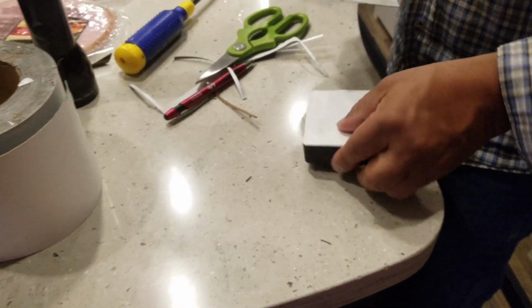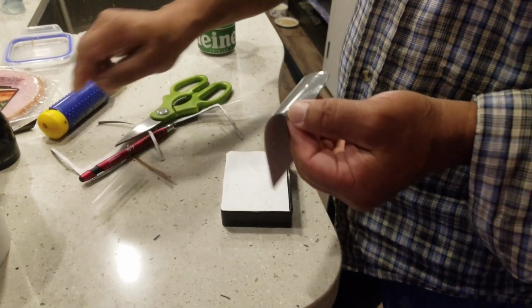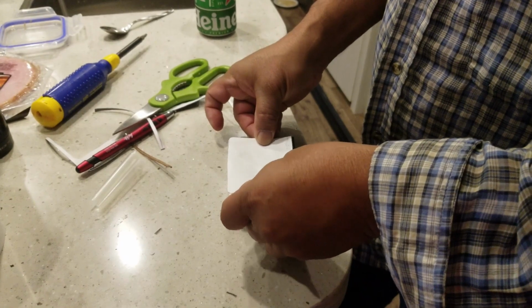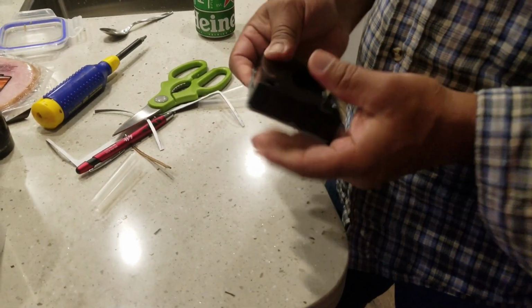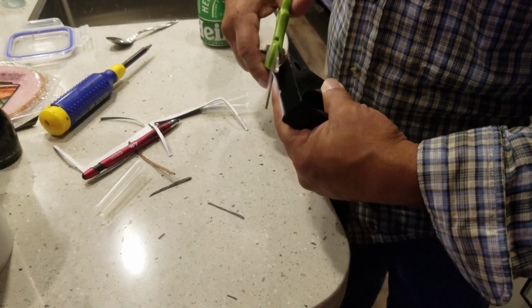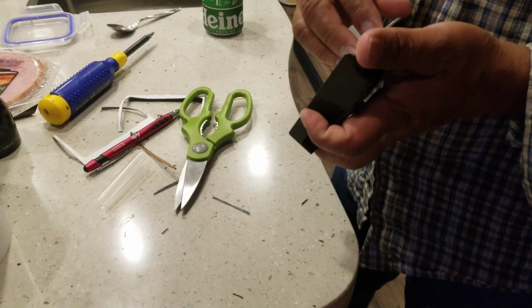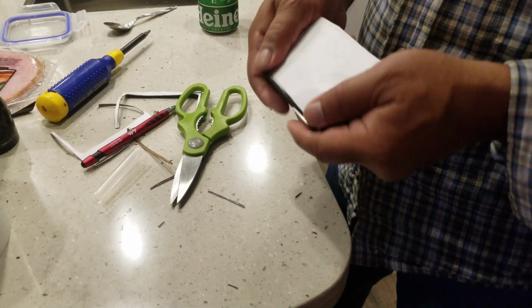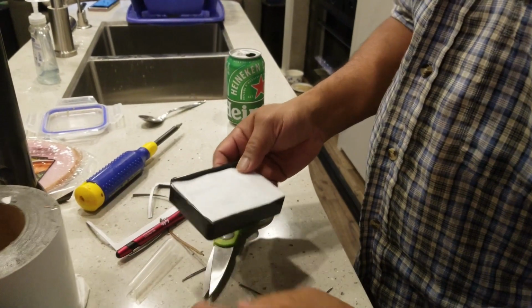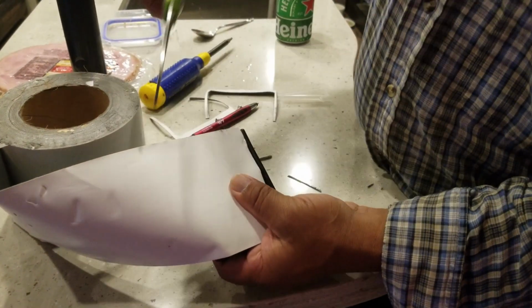Alright, so got one on there. I'm just going to peel this off. Peel the plastic off. With a steady hand, now that should do the trick. Now I just cut off the excess here. But at least now we know, even while we've just had that out, that it's not closed up. Our fridge has already gone up to 42. That was my problem. I couldn't get it. I was like, why is it not going to 34, 35? We'll do one more layer. But of course, that's because we have the gap in the door right now, because it's not sealing.